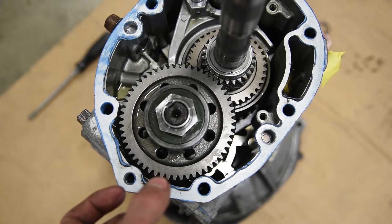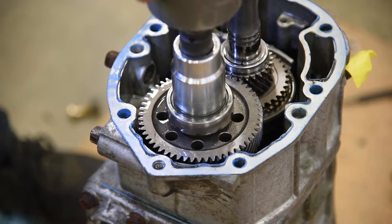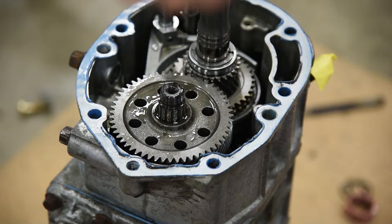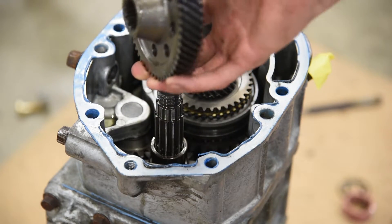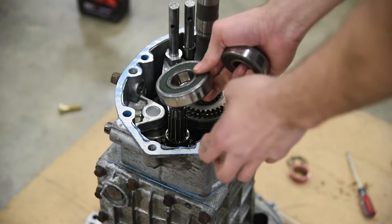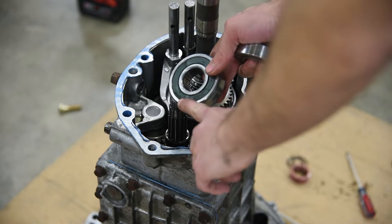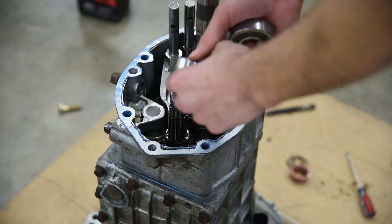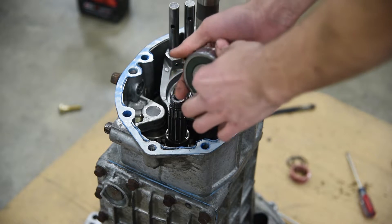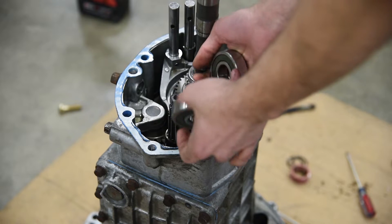That crush is just a safety mechanism to keep the nut from spinning off if it was ever loose. I'm going to pull that off and then pull this bearing off. I did use excessive force to remove this bearing because I didn't have the proper tool and it broke the inside, so this is obviously junk. With a real bearing puller, you're putting a lot of force on the outside ring — pulling upward on the outside shortens the lifespan of the bearing. Especially with a lot of horsepower, you really don't want to run these same bearings after removing them.